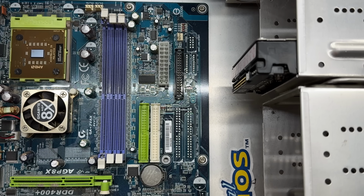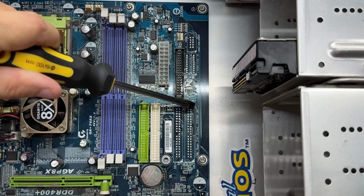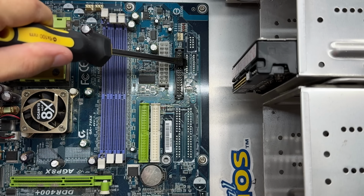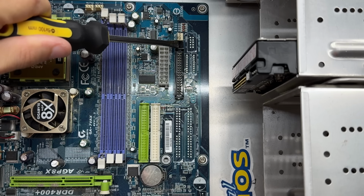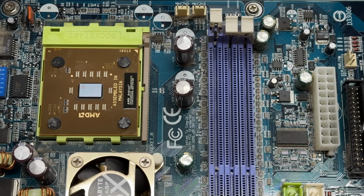There's quite a lot of unpopulated stuff on this motherboard. See, it could take 2 more IDE channels, presumably for RAID. We also have unpopulated headers for Sony memory sticks and SD cards, as well as a smart card reader. This would have been a pretty capable board in its max trim. And we do have some bulgy, plaguey caps, but they look like they'll last just long enough for a test. There's no sign of them actually leaking. I think we'll be able to get away with it.